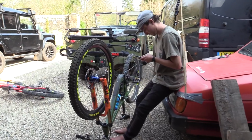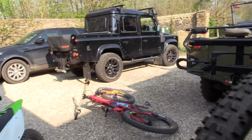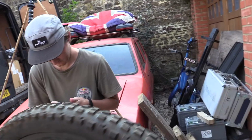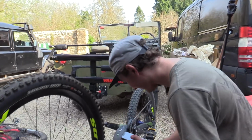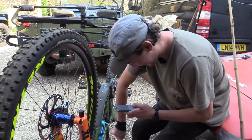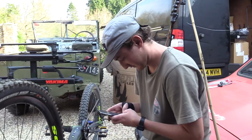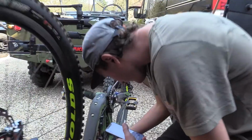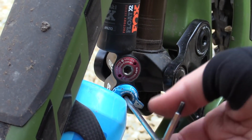Let's do it. I reckon Switchblade settings, same as what's on this one. It's 2020, we've got X2s on both bikes, and 36s, so how many clicks are we actually running for people? I don't know yet, I'm about to count how many clicks. From open, right, Jordy? From open. 13 high speed, 13 high speed people is what we're going for there. 14 low speed.